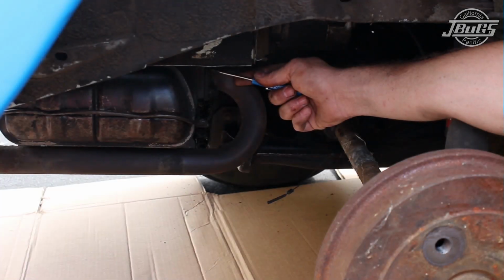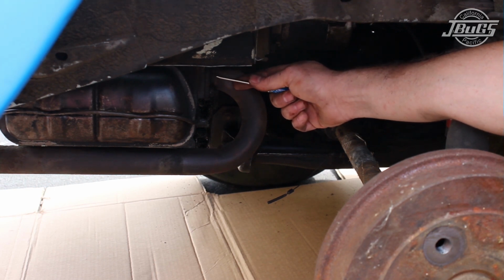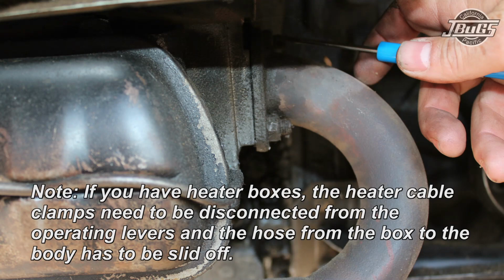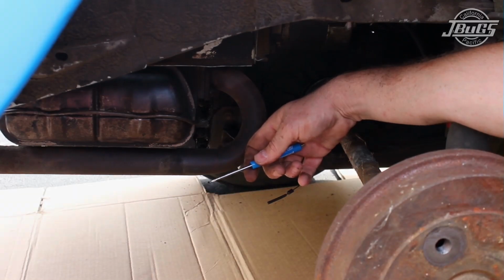By no means do you have to pull off the tire to remove the J-tubes. We've just done it so it's easier to see in the video and or photos. We're going to pull off the 2 nuts here, one at top and one at bottom. We'll do this on both sides. That also allows us to pull off the J-tubes and replace these while we're here as well.